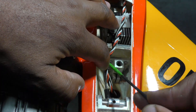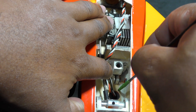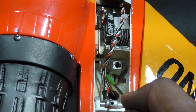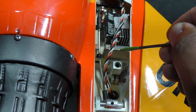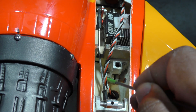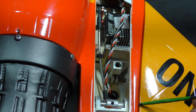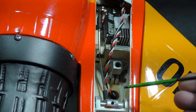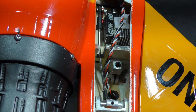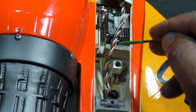The third thing I want to show is this clamp right here, which is what holds your vertical stab in place. You want to make sure the four screws that hold it to this bulkhead are secure — one, two, three, four. Inspect and make sure that mount is good. There's a key on the rotation pin here that allows it to mate into a structure inside, so there should be only one way for it to go in.